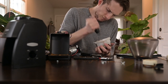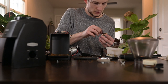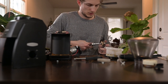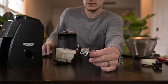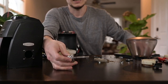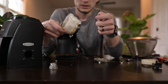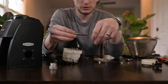There's a gear in the gearbox that will also come out from that. Beyond that, it's about disconnecting the drive shaft, which is actually very difficult — I had the hardest time with this. It's a reverse thread, and I had to get a deep well socket for it because a stubby socket wasn't enough. I used a pair of pliers to grip the burr. I would recommend replacing that drive shaft if you're going to replace the bottom burr — it just makes the process a lot easier. I damaged that drive shaft and was still able to get it back together, but I kind of wished I'd paid the five bucks and gotten a new drive shaft.